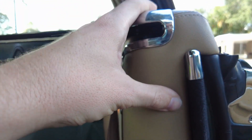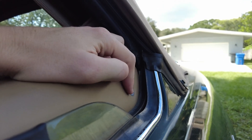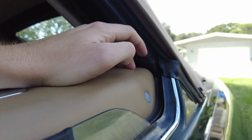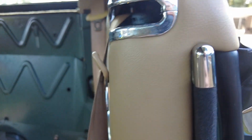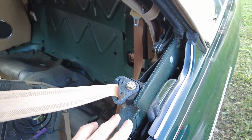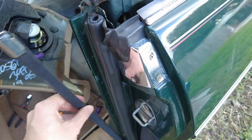Now we're working on removing the side panels. They're relatively free other than being hooked on the sill plate — looks like we can get it up and over. It seems like a little plastic clip is what's holding pretty much the whole panel in. We're carefully trying to pop it out without damaging the leather. To fully remove it we might have to do something with the seat belt or remove the track along the bottom, but we may get away with just pulling it forward and looping the seat belt through.